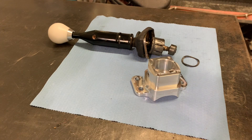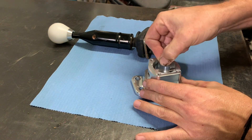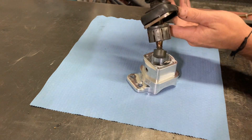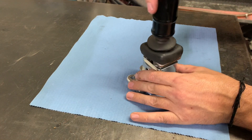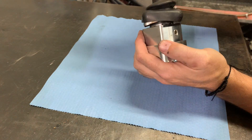The first step to assemble the new shifter housing is to take the old spring washer after cleaning it and slide it in around the pins of the shifter housing so that it goes all the way to the bottom. Now you can install the old shifter in the same way — slide the lower bushing around the pins and then rotate the shifter until the grooves on the side align with the pins as well. Once everything lines up correctly it should slide into place.